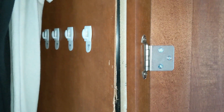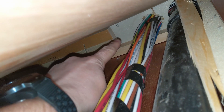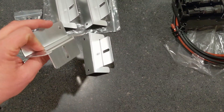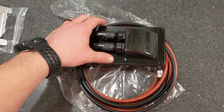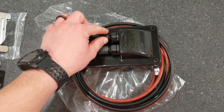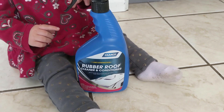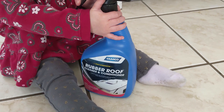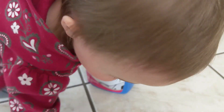We've got this panel off now. Here are all my connections — I've even got a vent pipe here, which could always be an option if you wanted to go through it. It might be a risk to just drill right there because you could drill through some of these wires and not even realize it. On the top side of the roof I'm using brackets to mount the panel. Here is my entry box — this is made by Go Power and I chose it because it has MC4 connections already on it. You're also going to need something to clean the roof, as most RVs have some kind of rubber or EPDM type roof.